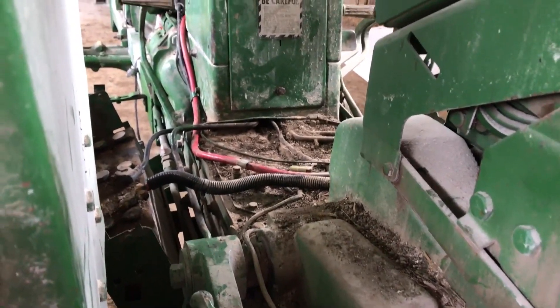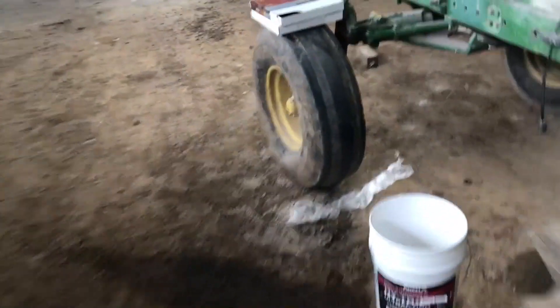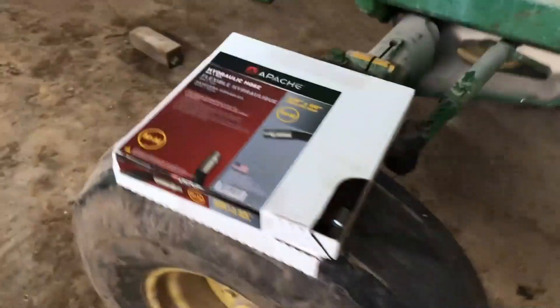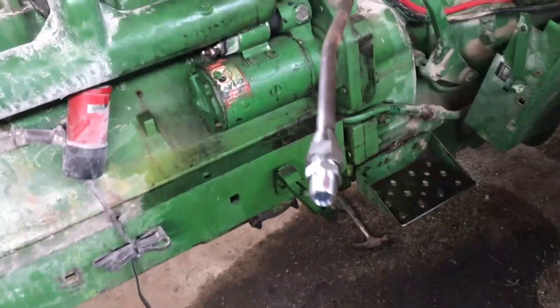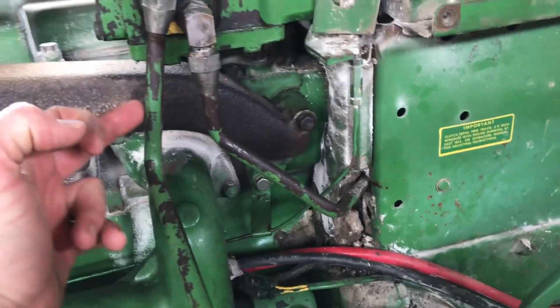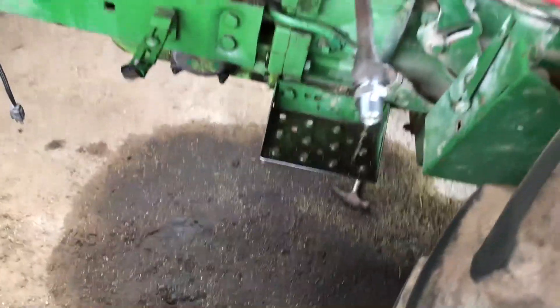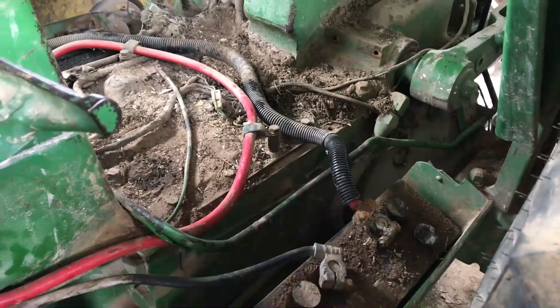It's Sunday and I can't get a hose made, so I went to Ace Hardware and got a hose and I'm gonna have to put some fittings together to make it work. Since the other line is kind of next to the hot stuff, we're gonna run metal line down under the cover and put rubber hose the rest of the way back. That's not too big of a deal — ideally we'd keep the metal lines, but we're gonna run the hose.